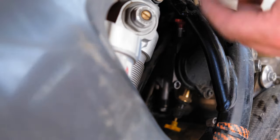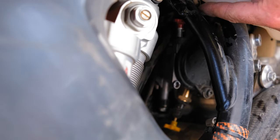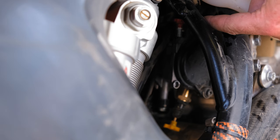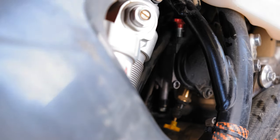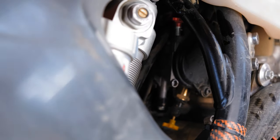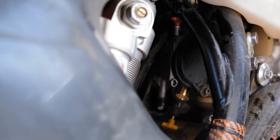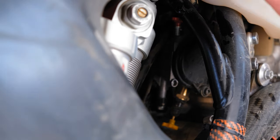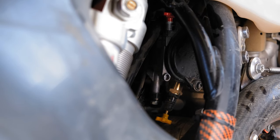When you start to operate the throttle, that pops back out and shuts the butterfly, and then you run based off of the red screw, which is your idle screw. You want it to idle around 1800 RPM according to the manual, which seems really high, so I set it by ear. If the idle is not right the bike won't start — if it's too low, which was a problem I was having — and I tried to fix it by adjusting the yellow screw, which is totally wrong.